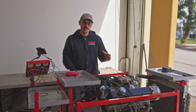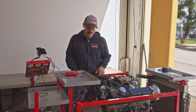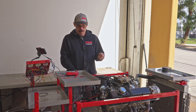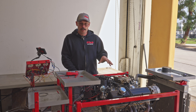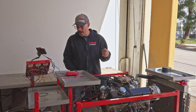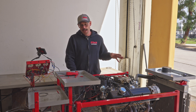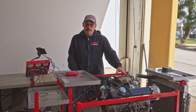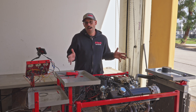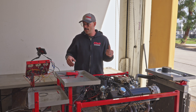Another thing you may run into is having your key wire hooked up in a location like the choke wire, or another spot where voltage drops low during cranking — that would also make the system shut off. The minimum voltage for the EFI system is 10 volts. If battery voltage or the key wire drops under 10 volts when cranking, you can't expect the EFI system to start an engine. The ECU can stay on at slightly lower voltage, but you're in a gray area with no real success rate. So 10 volts is an easy number to remember — make sure your battery and key connections stay above it.